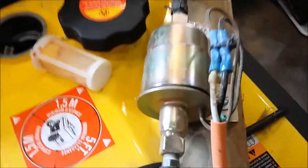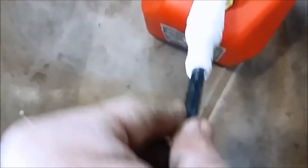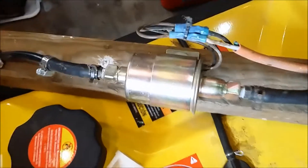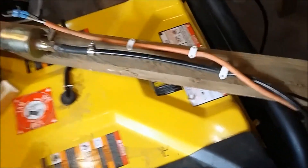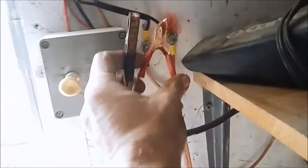What I've done is taken an old 16-gauge extension cord and used the black and the white wires. The tubing size has a little slack so it lets air get by nicely. I've also got a vented can with a little vent in the back. All you need is a set of alligator clips. This unit has been used for draining fuel tanks of cars. I put about 15 feet on this end and it'll pull fuel no problem — it's self-priming. You can hook this up to a car battery using just 16-gauge wiring because it only pulls about an amp and a half.